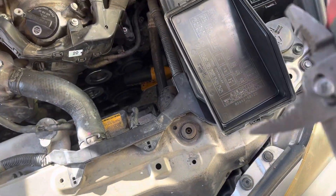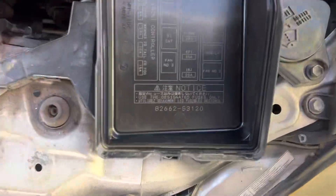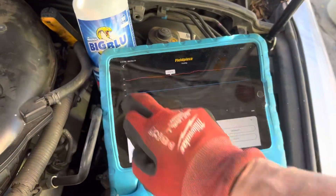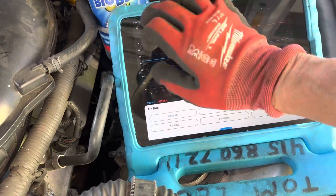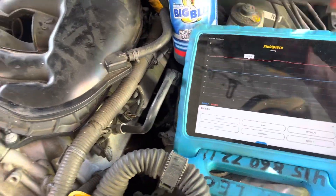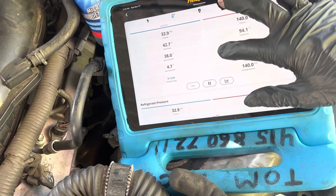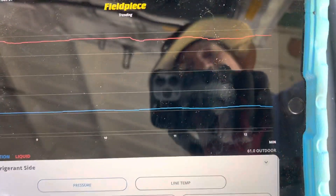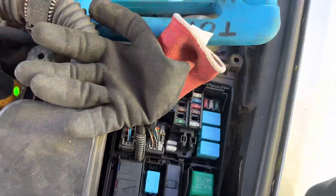All my failures come from not being prepared to make videos — I always do them last minute. Trusty old relay strap. Fan two — let's take off fan two. Let me look at the pressure. We have our pressure on screen. Let's pull fan two out. Our high side pressure is at 140 PSI. I'm going to pull fan two relay out.